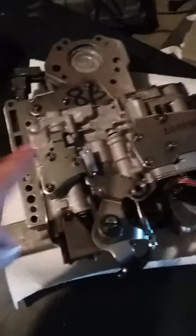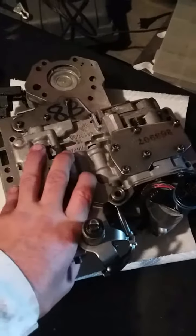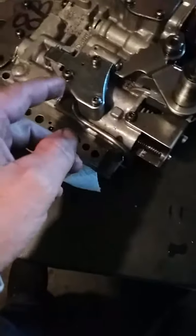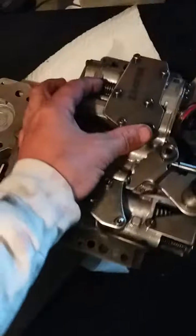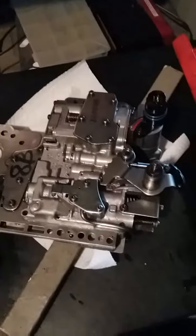We got her back together — really clean. I got the new part installed, and the accumulator spring — I wanted to replace it but I don't want to wait for it, so we reinstalled it. Everything was fitting really well, I didn't see anything marred up, everything slid really well. I kind of pushed all the valves I could access in and out. Some of them you can get a tool on; once I had it off I slid it in and out to make sure it slides smooth — it does. All the other ones I could get to as well. Nothing sticking, very smooth operation. Now we're going to reinstall it.